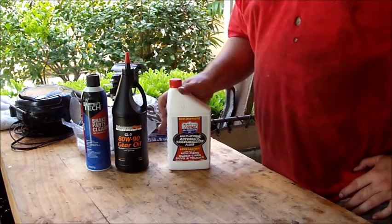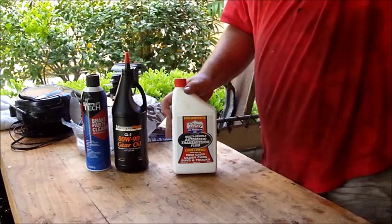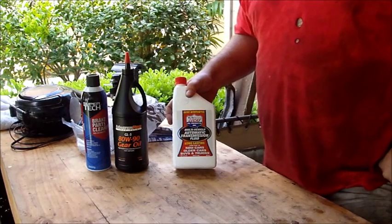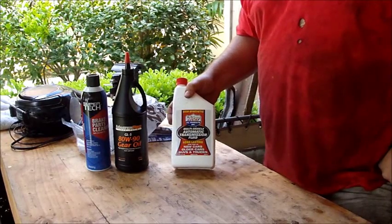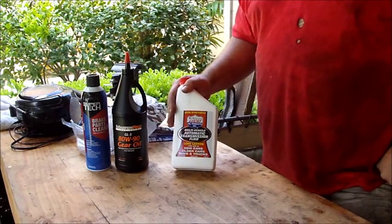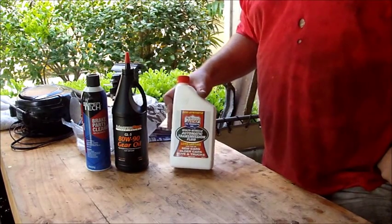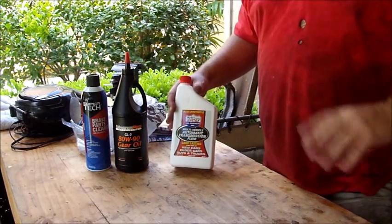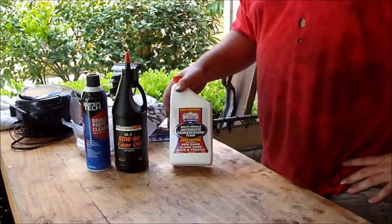So for the ZF5, we're going to pull the drain and fill plug at the same time. We're going to pull the fill plug first, then the drain plug. We're going to refill the transmission from the top, pulling the stick shift and refilling. We're going to refill with about half a quart more than the manufacturer recommends. We're going to put in 3 quarts of this semi-synthetic transmission fluid and a quart of stabilizer, and hopefully that's going to get rid of all of our gear rollover and shift grind and get our synchros settled and working again. May or may not, we'll see. I'm trying to get rid of that third gear harsh grind.